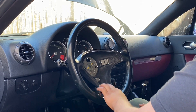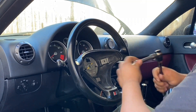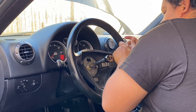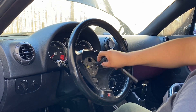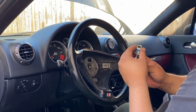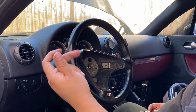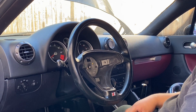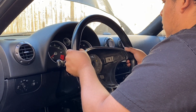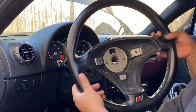Just making sure that the steering wheel is centered. I'm going to be using an M12 triple square bit. This is the huge bolt that's in there — it's as thick as my thumb. Right here's the clock spring, I don't want to move that at all. Steering wheel is out just like that.